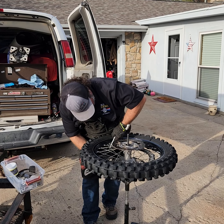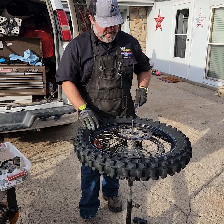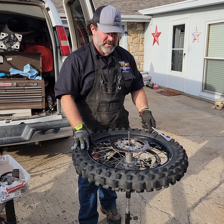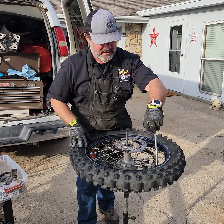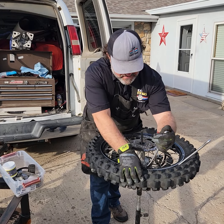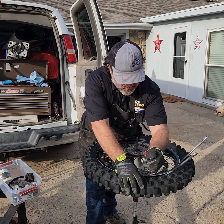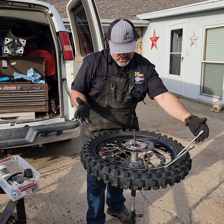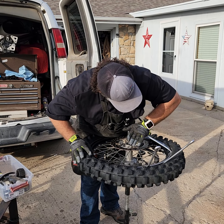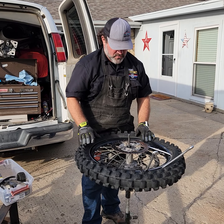Make sure that the rim lock is loose again. Put your iron on it, get a good straight pull on it and you'll feel it kind of give up, and then once it does we want to put that at nine o'clock. So now we're in bed — we try to get to bed by nine o'clock, but sometimes we work late and we don't get there till eleven. We just put the spoon in at eleven. If it's a really bad night it might be midnight — put that one in at midnight. With a third spoon we've been working really hard, so we put it in at one o'clock. We're gonna pull eleven o'clock over — make sure you push down over here and then pull it over. Open your hand up so if you accidentally come over real fast you don't knock a knuckle.